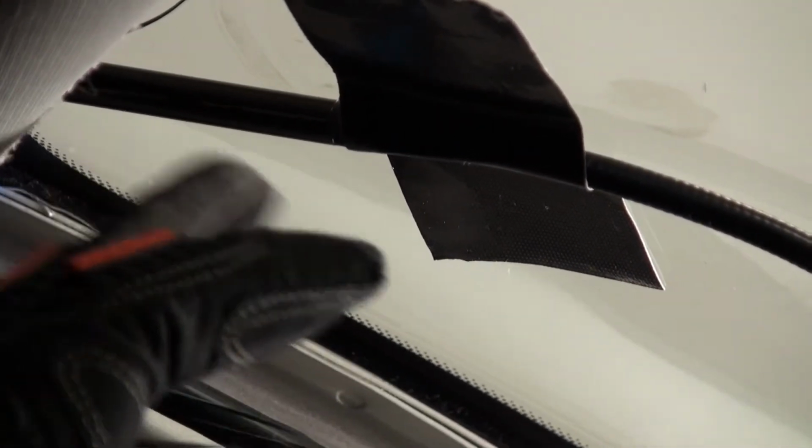So we're obviously up in the driver's top corner. We've put our little lens scope right in there. Now we're going to go to our screen to show you our setting post, the yellow setting post. Now you can see that very clearly. Towards the top would be the windshield and obviously our post. Now I'm going to take this trim protector and show you where to position it. And then we're also going to watch the string cut through the urethane and slice off the adhesive that holds the setting post to the windshield. Okay, now we're going to show you how easy we slide the duckbill in.